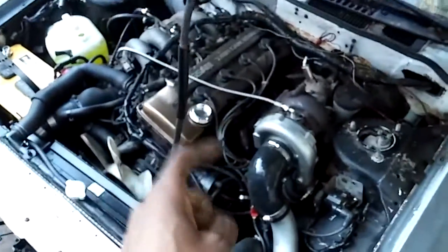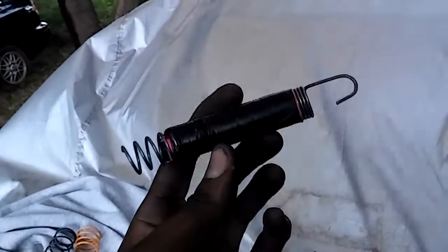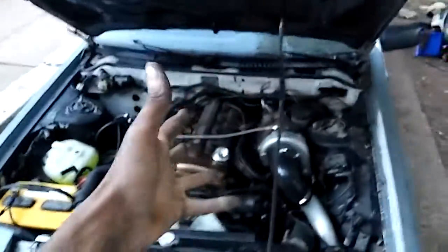Then I'ma show you guys on Instagram what I used as that spring. I'm telling you, it's a piece of this. It's a piece of this damn screen door spring. Alright, I'ma wrap this up — follow me on Instagram, I'm gonna show you guys that I used a piece of this spring to make a 5 PSI wastegate spring for a 38 millimeter wastegate. That's the video title: 'How to make a 5 PSI wastegate spring.' Like and subscribe, homies. Have a nice day, bye.